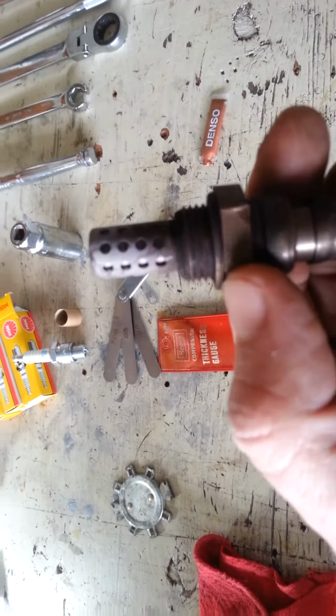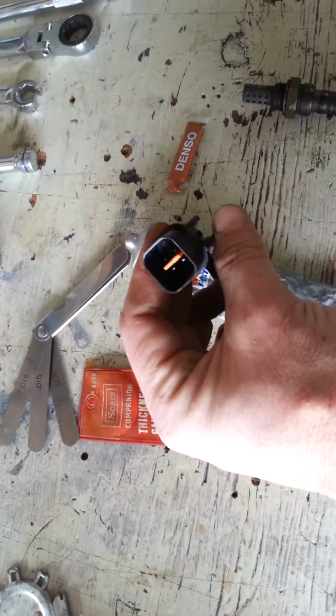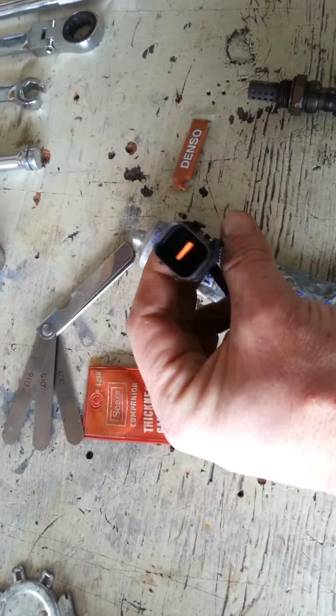One last thing, well, actually a couple things. When you put everything back together, I suggest checking all your sockets. Make sure there's no corrosion, no garbage inside there. Make sure the weatherproof fittings are still inside the fittings. And then this is one case where actually you can't hardly use too much. This is dielectric grease, and go ahead and put it into all your female sockets before you plug them in. These cars have a history of electrical problems, so anything you can do to help prevent water getting where it's not supposed to, prevent corrosion, prevent bad contacts.